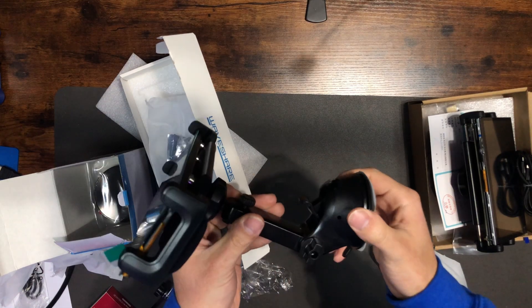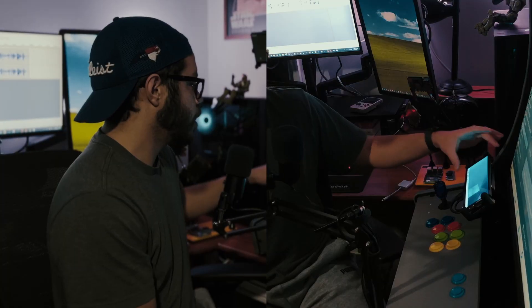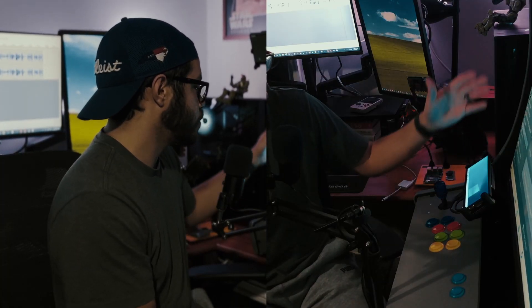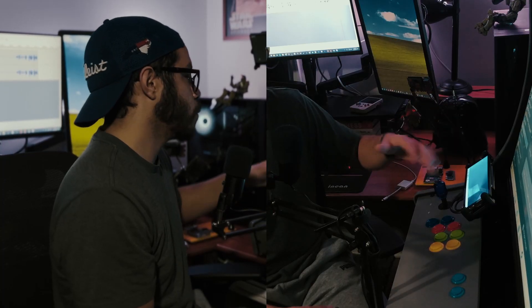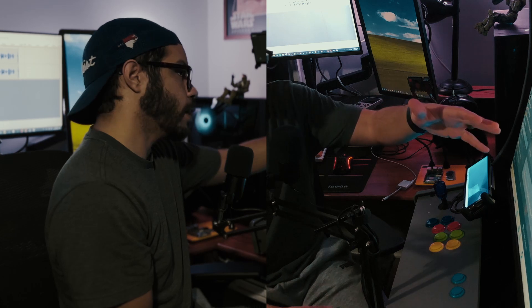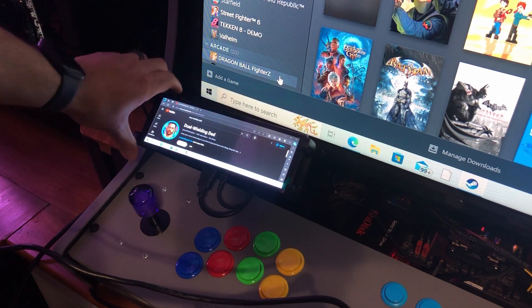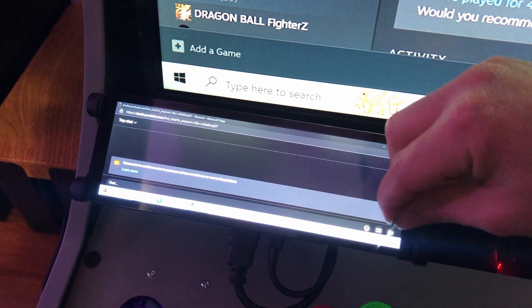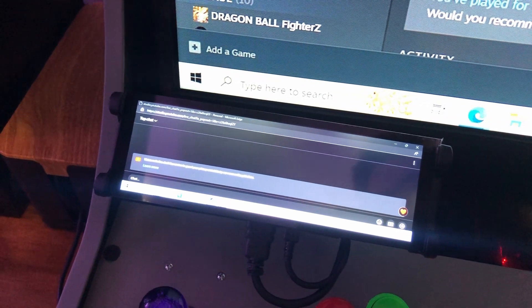The next mod is this little screen down here. It's not a touch screen — it's a 7.9-inch diagonal screen, but actually about 2.5 by 8.5 inches. Its main purpose right now is just to show chat. Since it's not a touch display, I didn't want to install another Raspberry Pi or Android on it. I just hooked it up to the graphics card in the PC, it gets power from USB, and it's connected to the motherboard. So think Android tablet plus dual monitor setup essentially.